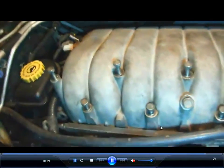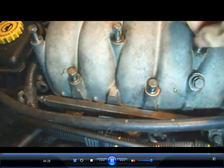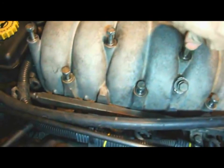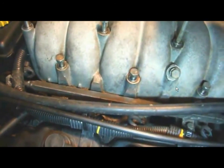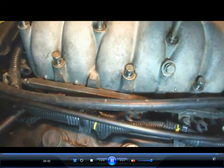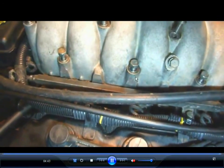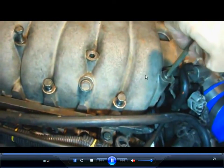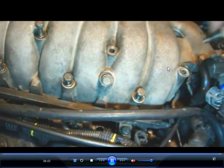The intake manifold itself has 7 bolts. They're 12 millimeters. That's the socket size you have to use. I'm not saying the bolt thickness, I'm always saying the socket size. 12 millimeters. When you reinstall this, they're torqued down at 168 inch-pounds, working from the center outwards, like 1, 2, 3, 4, 5, like that. That's 14 foot-pounds or 168 inch-pounds.